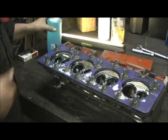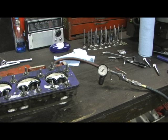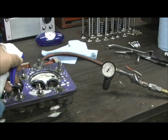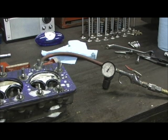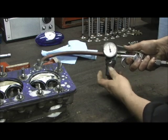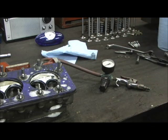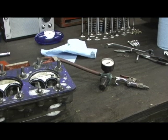I thought I'd show you the pressure — it's almost at 40 pounds. You can see the high spray as I go in there and do it, and you can just tell there's nothing coming out because it would blow right up. I'll go ahead and release it so you can see it was pumped full of air. Now I'll do the other head and then we're down to the last thing — putting them together and setting spring heights.